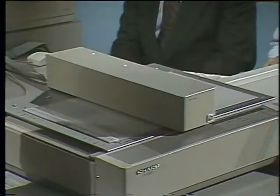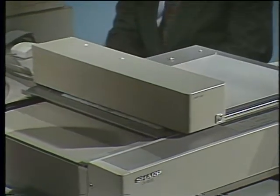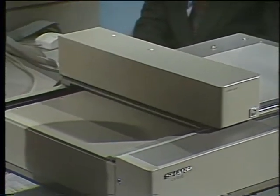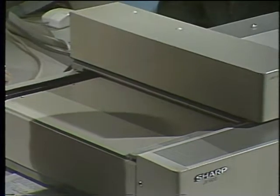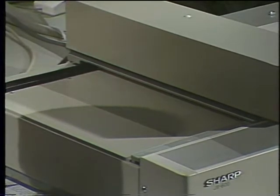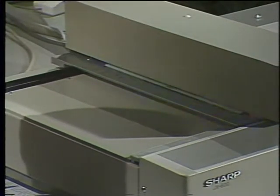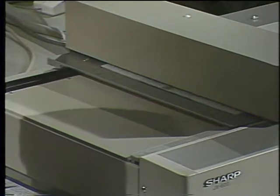Let me begin a scan right now, and we'll see some of the characteristics. As with the Epson, this scanner is also a single-pass scanner. The first thing it does is position itself over a white bar where all 6600 CCD elements are sampled and adjusted for the light from the unit on the top. You notice the pretty colors. Setting itself up here, it's sampling three colors in each pass. Okay. So at that point, after it finishes doing the white bar sampling, it'll move over and actually begin scanning the image. Right. And the time it takes will depend on the resolution of the scan.